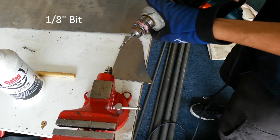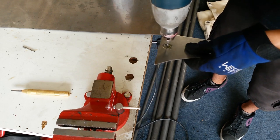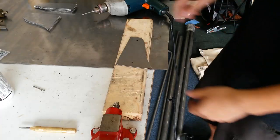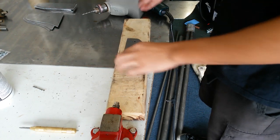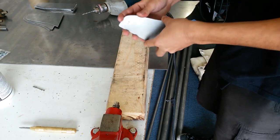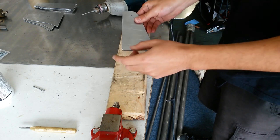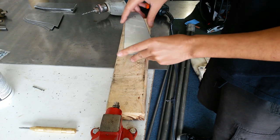Based off of that I'm going to line them up with the rest of the plates that I have and then drill the rest of the pilot holes for those as well. To start off I'm using just an eighth inch drill bit. So there's our one template cut out, and now we can just go ahead and stack the rest of them one by one on top, then drill in the same exact spot, and that way we get all of our base plates looking exactly the same with the exact same holes in the exact same spots.